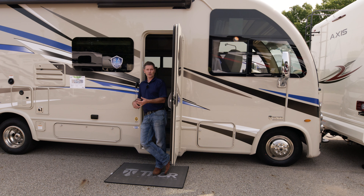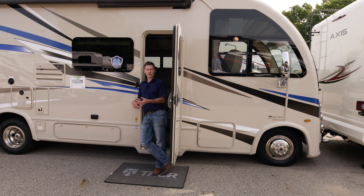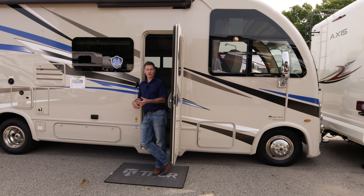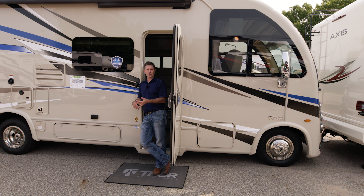We also talked about keeping the batteries charged during storage. Using a 110-volt adapter on the end of your 30-amp connector, you can plug that into an outlet in your garage or wherever you store your motorhome to keep a little charge going to your house batteries so they don't go completely dead. Or, before a trip, you can get your refrigerator running ahead of time. That's how you hook up your electric.